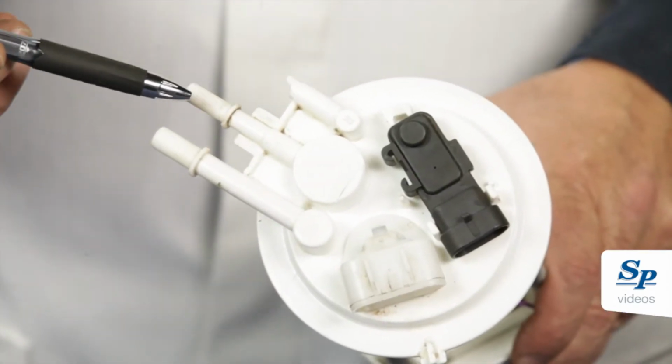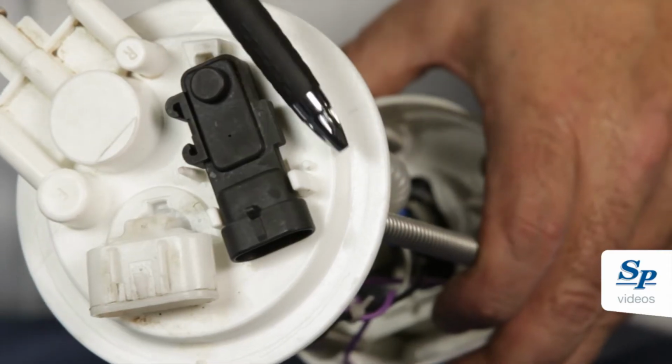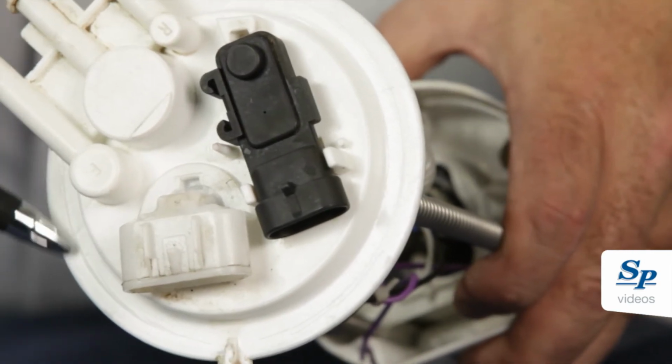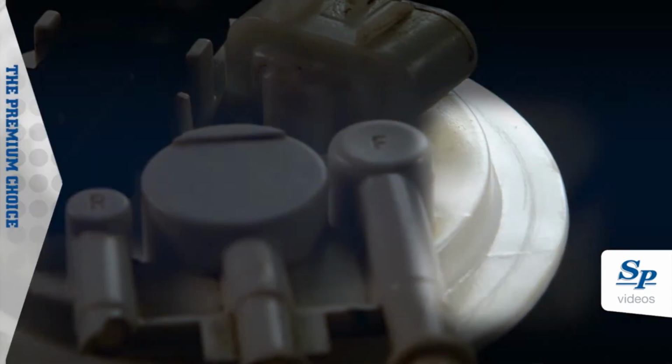When fuel pump tubes such as the supply or return are broken, look for installation signs. These signs confirm that this happened during the installation. Dirt and scratches around the flange on the top cover are signs that pressure was applied to the tubes during installation.